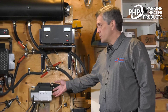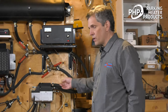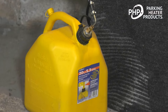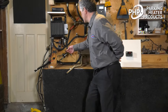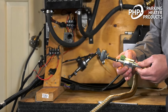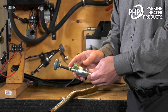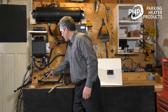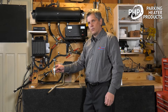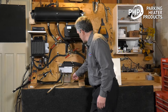For demonstration purposes, we've got the heater mounted on our test bench. We tap directly into the fuel tank — a five gallon jerry can — using our pickup pipe. From there, we have a two millimeter fuel line that comes up to the fuel pump. The fuel pump acts like a solenoid: we apply 12 volts, a plunger pushes and gives a shot of fuel. Remove the power and the plunger returns, the fuel cavity fills and waits for the next pulse. It's pulsing, and every pulse delivers a shot of fuel. The pump is mounted at a 15 degree angle — it should be mounted between 15 and 90 degrees to allow air to pass through it. From there, the two millimeter fuel line continues up to the heater.